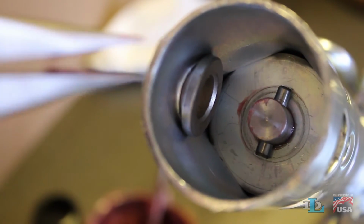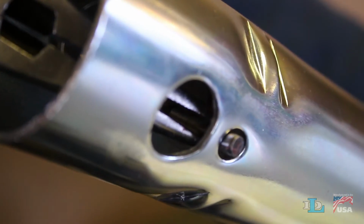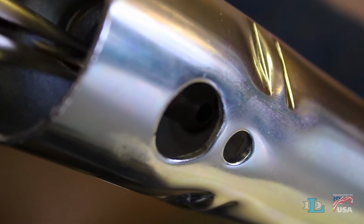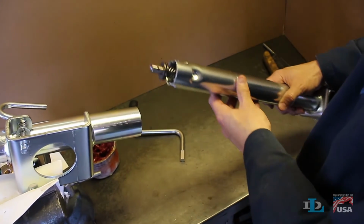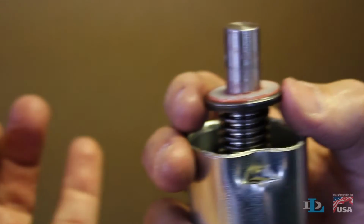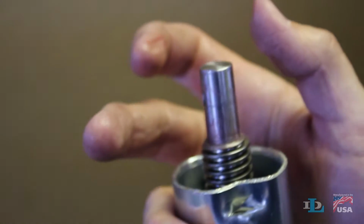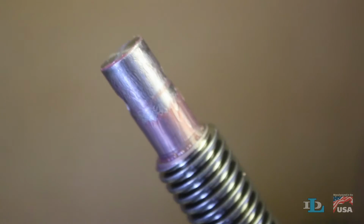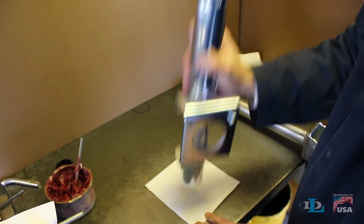Turn the wheel at the bottom of your jack until the dowel pin is aligned with the small hole on the side of the jack. Then continue holding onto the wheel while you use the hole to remove the dowel pin. Slide the jack's inner tube out from inside the large tube. If you see 3 washers on top of the inner tube screw, remove them and set them aside. If they aren't there, they are stuck inside of the jack's outer tube, so use a table or other hard surface to get them out.